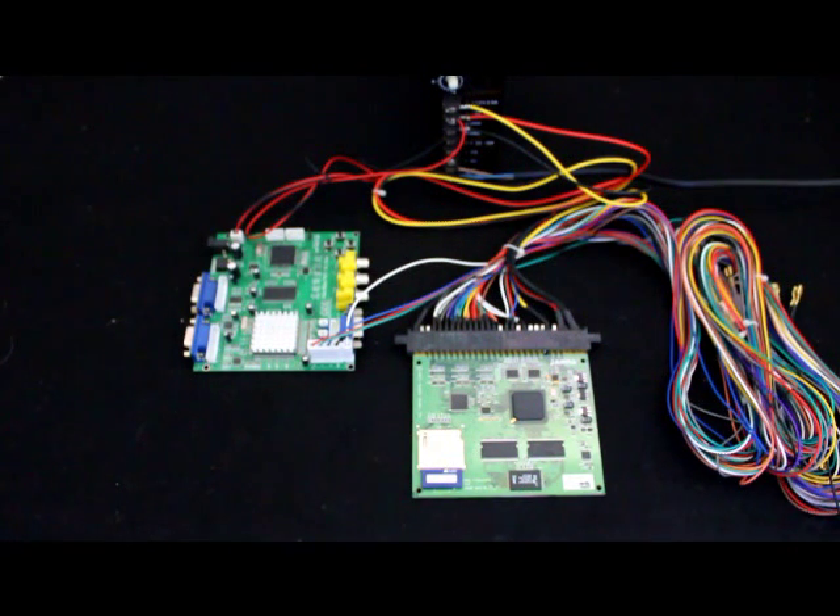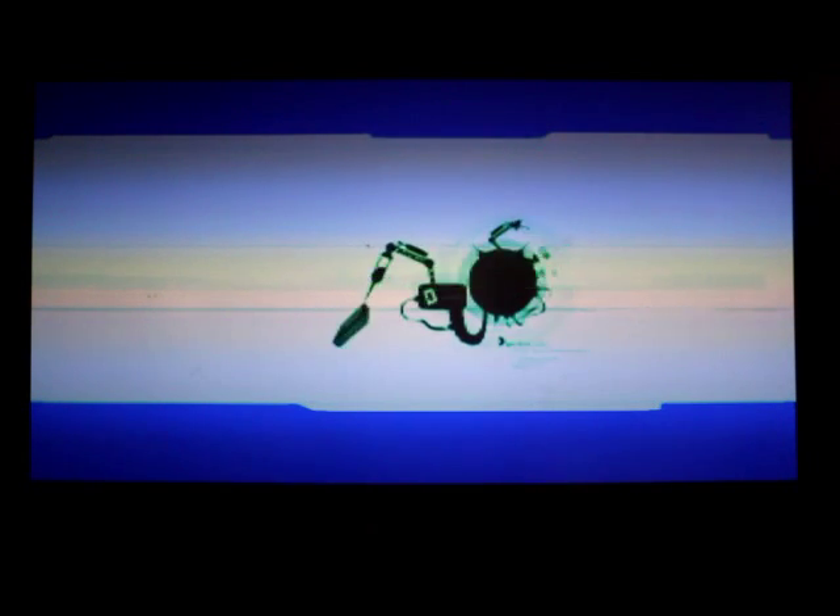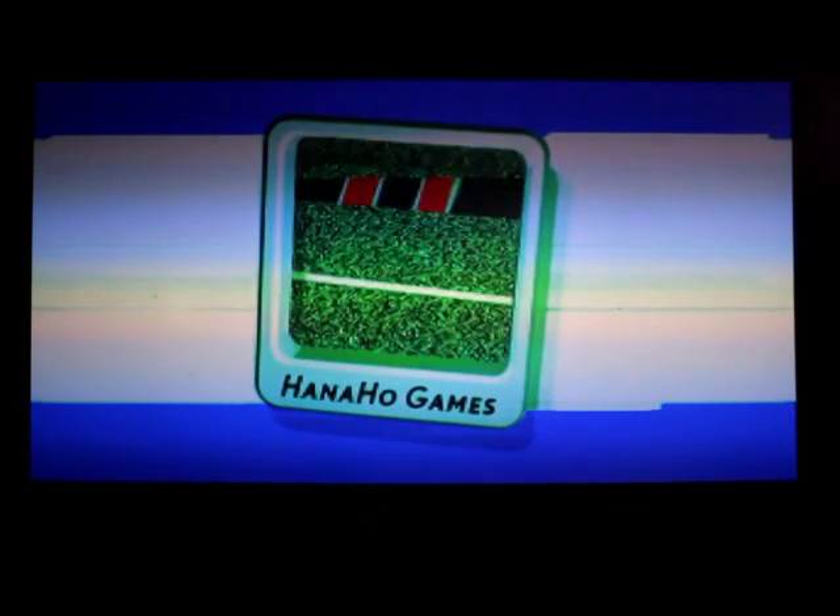So here's the basic setup — all we need to do now is plug this in and connect it to a VGA monitor. When we plug the board in and turn it on, it's aimed at my HDTV which I'm using as a monitor. You'll see Chinese characters that come up when it starts, then the board picks up and scans the signal. This happens to be a multi-Taito board. You can see that the green is adjusted too high, so we'll get in and adjust the green down once we're in the main menu.